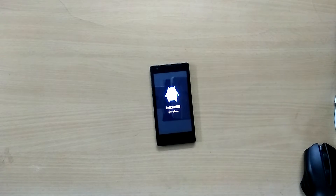Before proceeding, make sure that you have taken a complete backup of your device. To flash your custom ROM you need to have a custom recovery installed on your device. Since this ROM is based on Android 7.1 Nougat, it can only be flashed on TWRP recovery version 3.0.2.1 and above. In general, any 7.1 Nougat based ROM can only be flashed on TWRP 3.0.2.1 and above, so make sure you have the latest version. I will leave a link for the latest TWRP recovery in the description below.